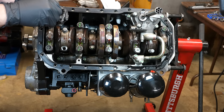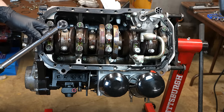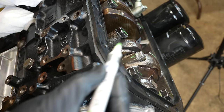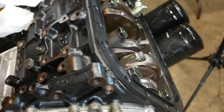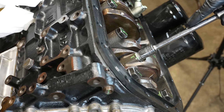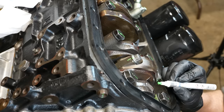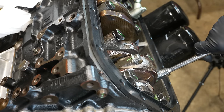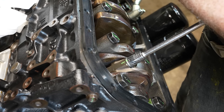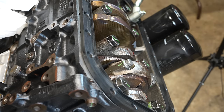This may have been fine as was, but at least it's some peace of mind, right? Okay, each notch should be 30 degrees, right? Since this is 12 point, 30, 60, about there. Actually, that's wrong. That's 90. I want 60, right, 30, 60. Let me get the other one going. It's a little bit past. There we go. All right. Just do that three more times.